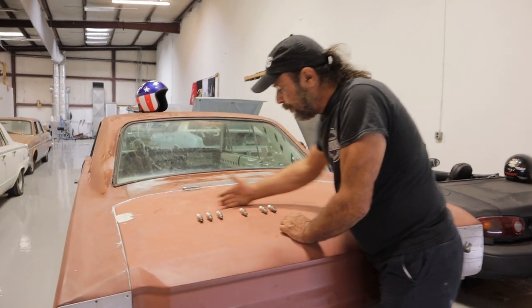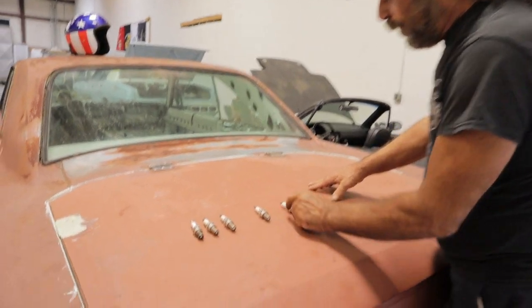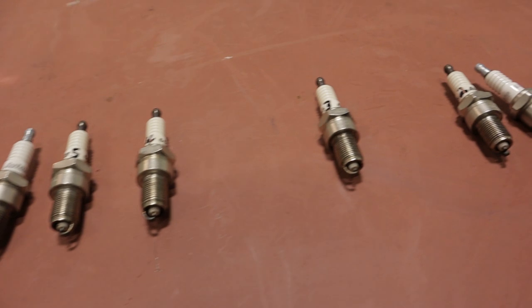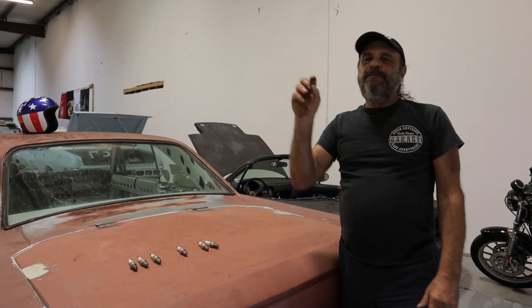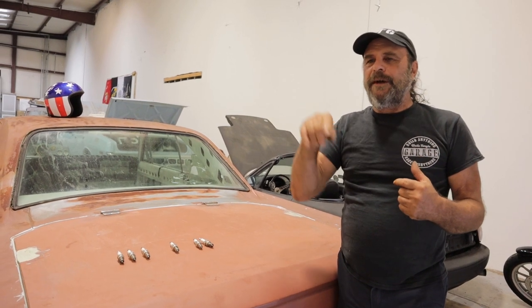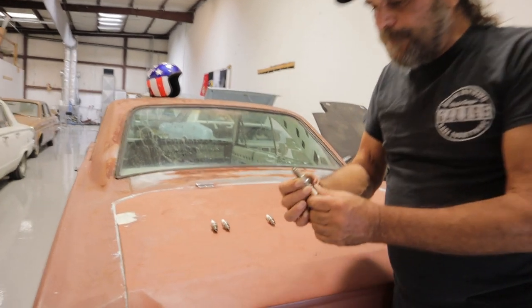Here's our initial plug read — six through one. I pulled the plugs and said to myself, oh my God, this thing is dead lean. How is it dead lean? I jetted it up into the mid-seventies and I would have thought it would have been too fat. Before we left, I actually considered backing down a jet size or two all the way around while keeping the stagger. But we just went. That night at the track it was 60 degrees, not humid — beautiful air — and that could account for a lot of the lean condition. But still, a couple of them are just absolute ghosts.